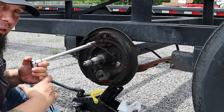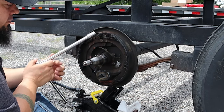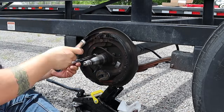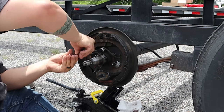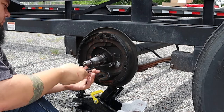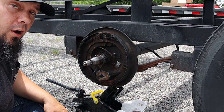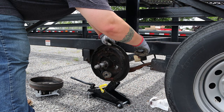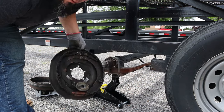The next thing we're going to do is go ahead and take these brakes off. It's just five bolts — in this case they're 9/16ths. The next thing to do is cut the wires off the back, then we'll pop this off and take it off. Now that we've got that cut off, we just tap it a little bit — it shouldn't take much. Comes right off, one piece.